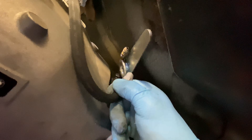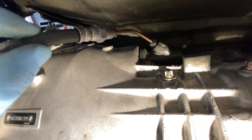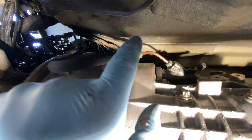We have our custom hard line mounted into our slave, and then we have a simple pipe bender. We can see where this is going and then bend our custom hard line to meet the soft line right here. After tightening up the custom line, I determined it was rigid enough in combination with this bracket. The soft line has nice clearance between the body of the car and the transmission, as well as coming up through the transmission into the firewall. That should work out just perfect.